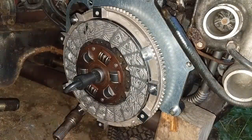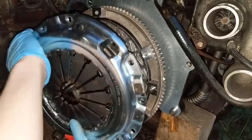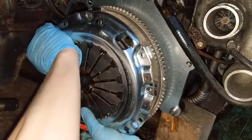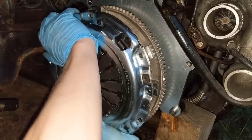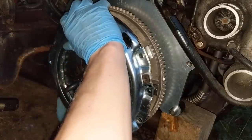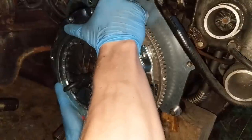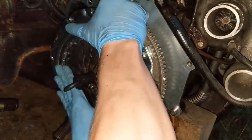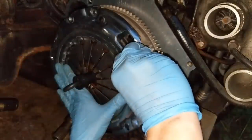And get your pressure plate. And I have already applied just a little bit of Loctite to each of the 6 clutch cover bolts. I'm gonna get this mated up and it should mount onto the dowel pins. Because I made sure it fit before I put it on the car, which is a good idea, of course, since I mangled these a little bit. That may actually be as much as I can get right now, so it might have been useful to actually leave the dowel pins out a little bit more, but just get some of the bolts started.